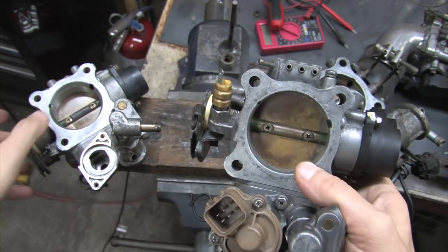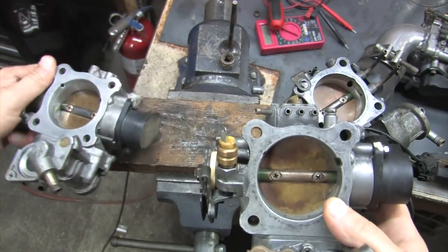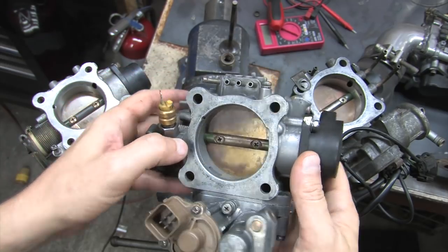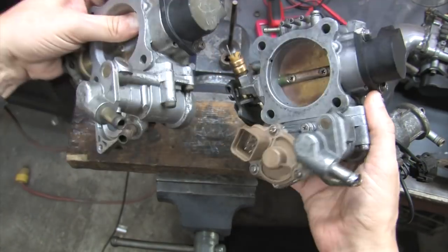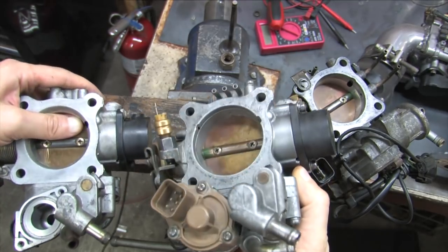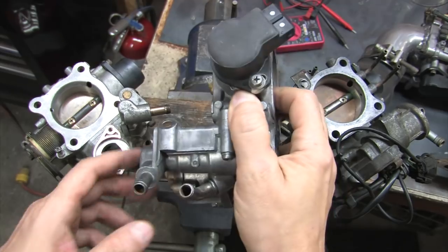You can still get that extra 6 millimeters of factory throttle body out of the deal, though, if you use the 91-94. The 91 throttle body fits your intake manifold flange bolts. The cheaper sensors are interchangeable. The ISC is the same. The wiring is the same. The only drawback being the routing for your water lines is mildly inconvenienced. The coolant nipples are similarly oriented, but the hoses won't be a perfect fit anymore.